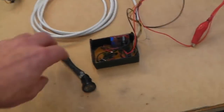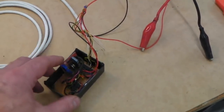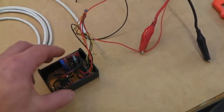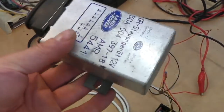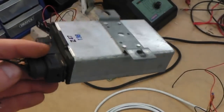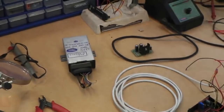Left you doing the multifunction warning lamp, the sequential warning lamps - all done. Tidy the bench up, that just needs a lid putting on it, a couple of little blobs of an inert seal. I think Tiger Seal - non-conductive - I can just Tiger Seal that board in there. If I ever have to get it out I'll prize it off, but I'm going to drill a little hole through the side so I can adjust the trim part if I had to. Once that's set, that's done - you're never ever going to need to get into that. Cruise control arrived so we can start working on it. Got our freebie - 20 quid - we don't know if it will work. They are renowned to fail these if you don't reflow the solder on them; renowned for bad soldering on the back of the board. We'll inspect that and see what condition it's in. Suffice to say Ruby's reflow soldering is faultless and the cruise control on Ruby performed absolutely incredible.